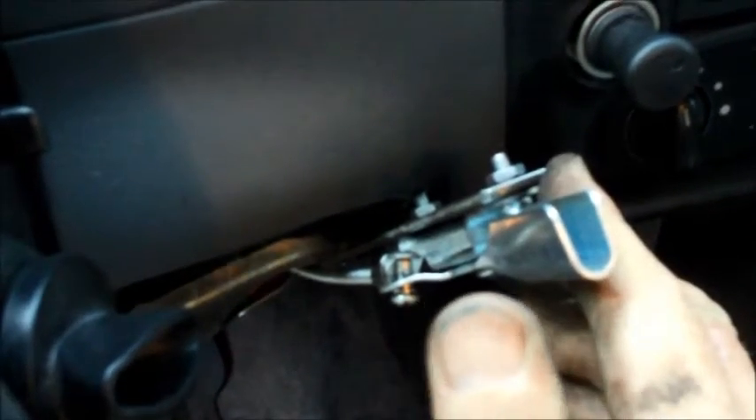The other modification is this — this is the control that controls the butterfly valve on the air inlet. You can see that's closed and that's wide open. When I'm running on gasoline I have this wide open; when I'm running on wood gas it's almost all the way closed. I've found that the onboard computer is able to switch very easily from charcoal gas to gasoline.